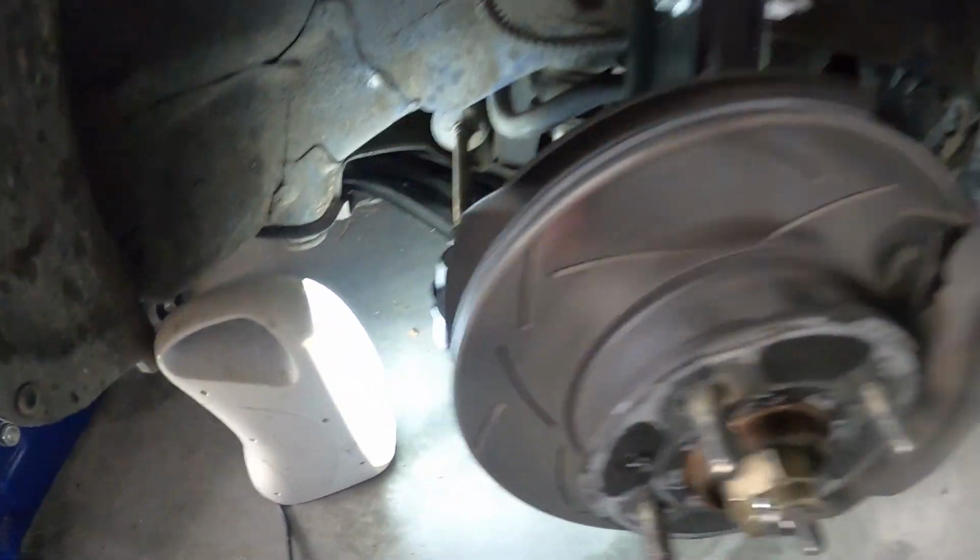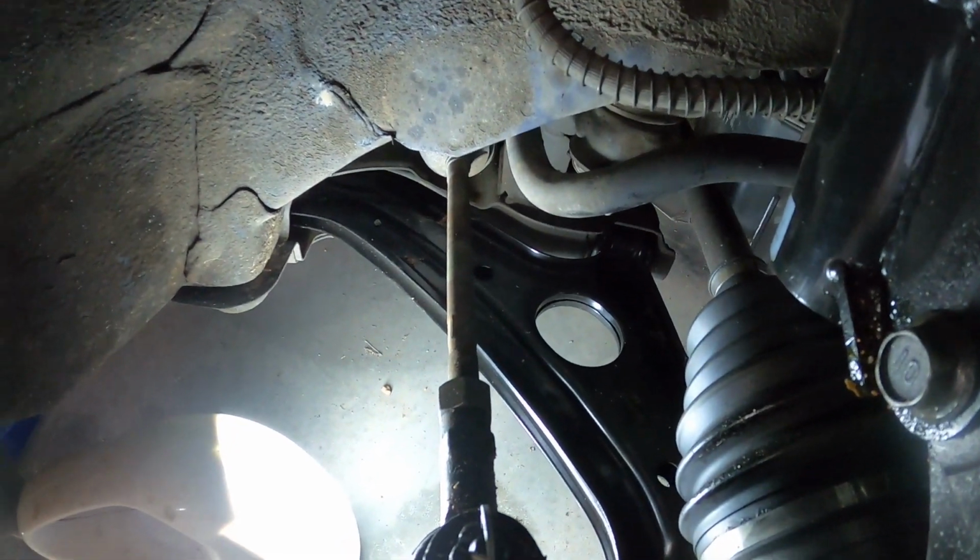All right, so the benefit of actually buying whole new control arms is if you reuse your old control arms, they're pretty thin gauge metal anyway, and you've got to get the old bushes pressed out, and then you've got old dungy bits of metal with brand new bushes in them. So we just got brand new control arms, and it was just as cheap. So that was all good.